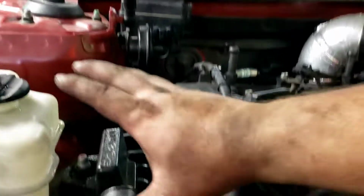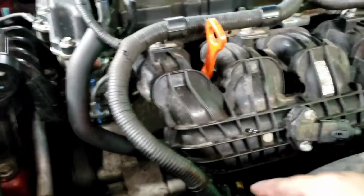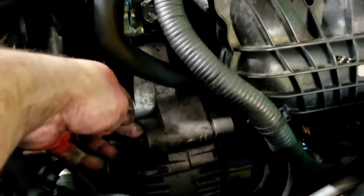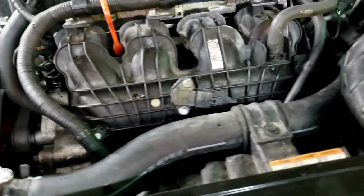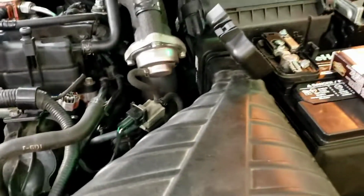But we got the motor mount back on, valve cover, got all the lines hooked back up, the alternator hooked back up. That was one 12mm screw for the ground, and then just a plug. 14mm bolts that go all the way through it. That's what you saw with the hammer. I had to tap it back in. It's extremely tight.